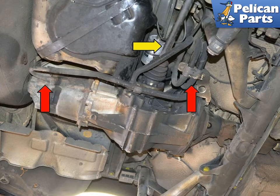The Porsche 951s have an external oil cooler. You do not need to remove the cooling lines. Once you separate and tie the axles up out of the way, the transaxle can be removed with them in place.